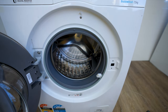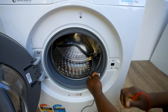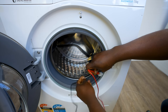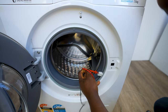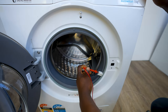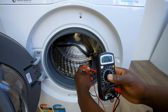Plug your washer back in, turn the power on, make sure you've got rubber-soled shoes on. I'm going to probe in there to see how much voltage is going in. The voltage doesn't come straight away — it's on and off. I can read something, I am getting something, but there's not much coming through — my multimeter isn't picking up much.